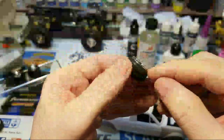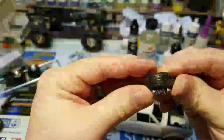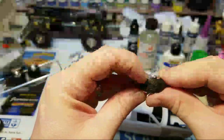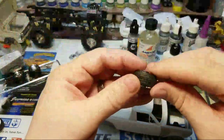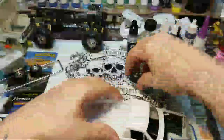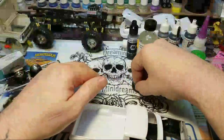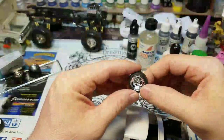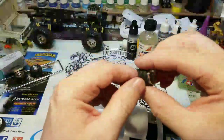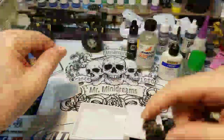So, a lot of this, guys, now you see here, I got the tire squished up to the edge of the rim. That's the way I like them. But then you see you got this great big old leftover wall here. Well, some of these guys are putting the tire way back and they're running a wild, big lip like that. It's a look that I'm not into. So I think what I need to do is I'll put it down flat like this on the table, and I'll make me a mark, and I'll probably cut these up and shallow it. I have enough room in the back here. It's not going to mess with the front of the wheel. And then the back is the same way.